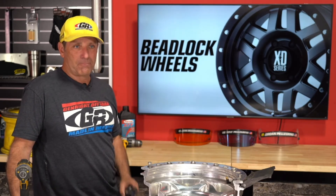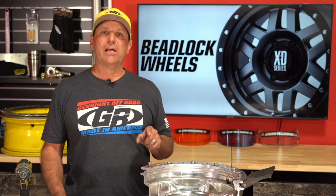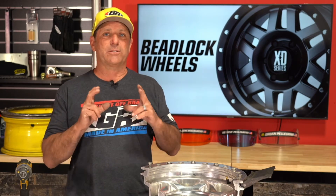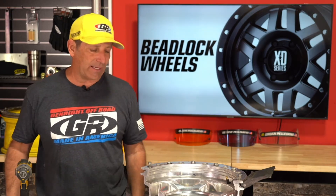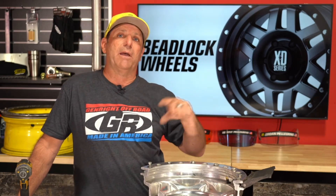Landland Contreras asked about gas tanks for the TJ behind the back seats. Go to our website, type BST in the search box, and every gas tank we offer — what we call a Behind the Seat Tank — will come up. You'll see several options. These are made to take your factory fuel pump module — sometimes it needs to be extended and we sell a little extender kit. It's got the fuel cap and everything, and can also be made to remote-fill quite easily. We've been making those for 15 years.